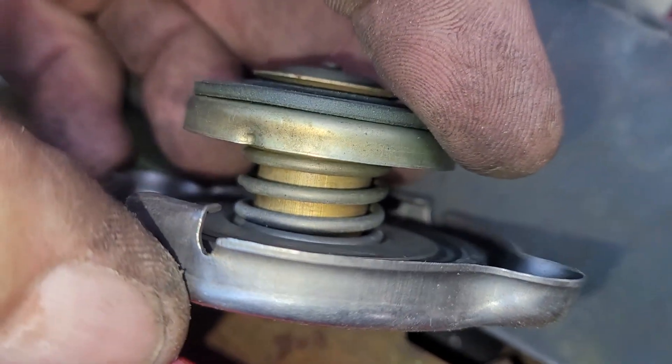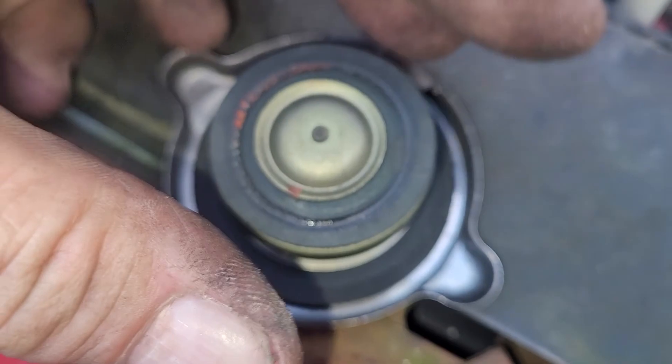You may have seen a vehicle with an upper or lower hose completely collapsed when it's cold — that's a bad radiator cap. It's not allowing the fluid to come back in. What can happen is the cap will push coolant out as the engine heats up, but not let the coolant return. It keeps doing that cycle, and eventually you'll push all the coolant out and overheat.